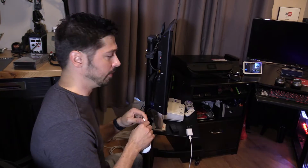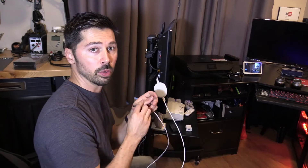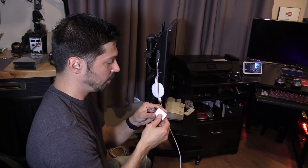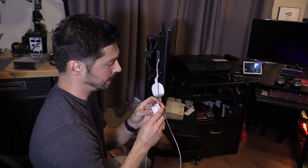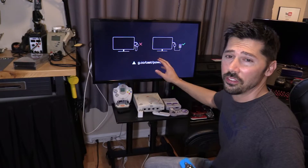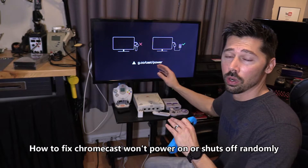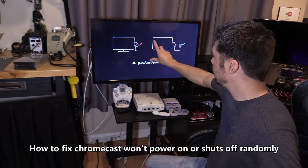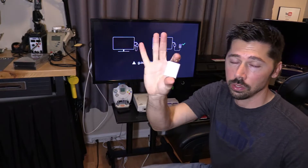If you want the Chromecast with Google TV to work the best, plug it directly to the TV and always use the original cables and power adapter. You can plug it into the USB port on your TV to power the Chromecast, but since it supports 4K it needs a little extra power. This power adapter is a 5-volt 1.5-amp power adapter. If your TV USB port is only 5-volt 1-amp, it won't be enough power. If you get a sound on your TV, you don't have sufficient power coming out of the TV USB port, so you have to use the power adapter — it's basically an error message telling you to use the power adapter.